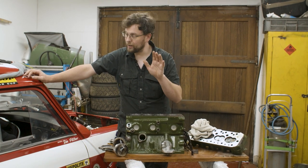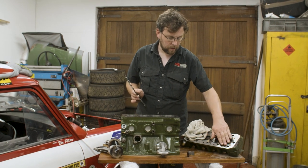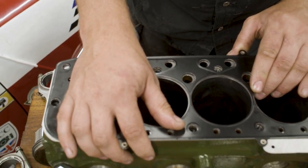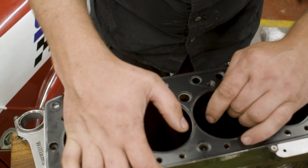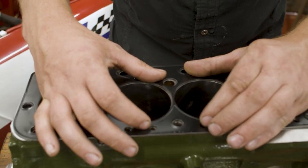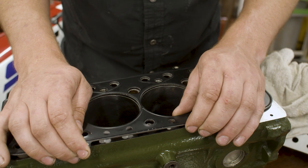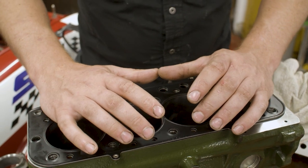With that we're also going to change gaskets. Now that we have a superb finish on both surfaces of the block, we can look at a different gasket — a multi-layer stainless steel gasket. What I want you to see is that as I put this gasket down, there is metal either side of the gasket, meaning the actual bore of the gasket is bigger — it has a greater size bore. That's going to mean the gasket has a much better surface to sit on, and being multi-layer stainless steel it will deal with much higher temperatures and less temperature variation.